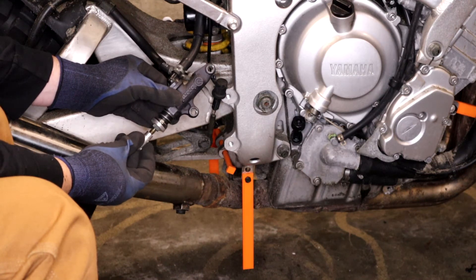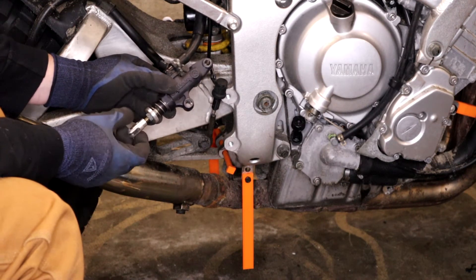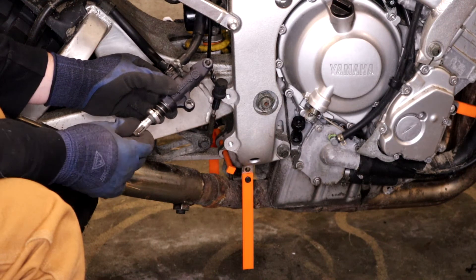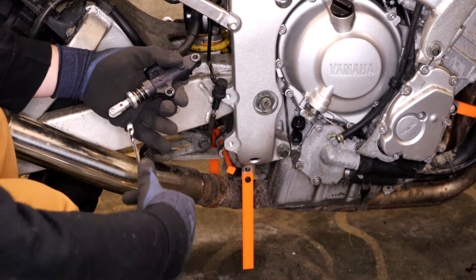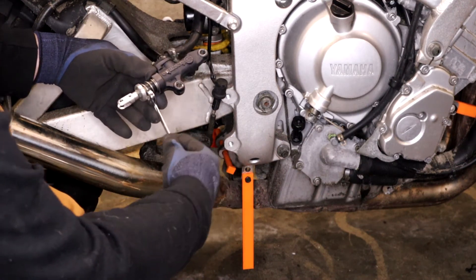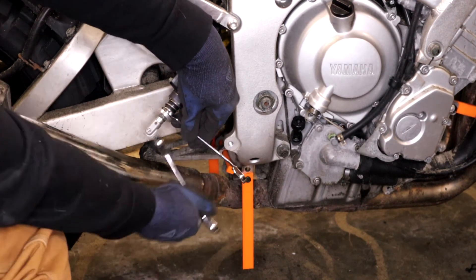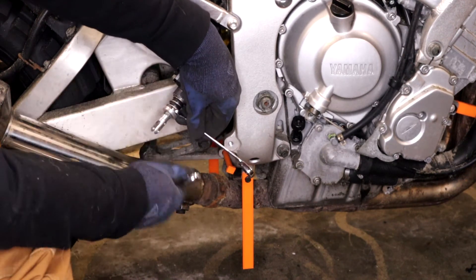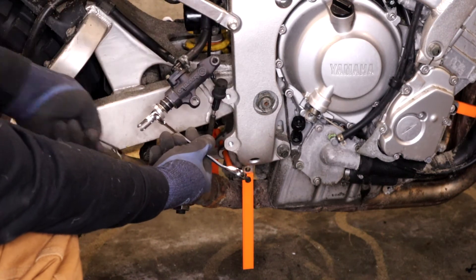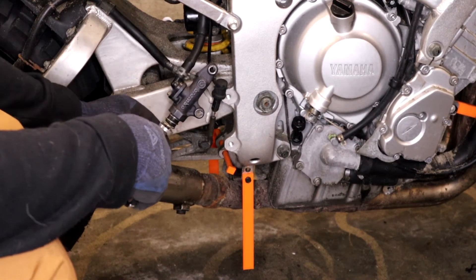Do be careful with this first thread — it's going to be real awkward due to the design of most of these main activation plungers. Be very gentle when you're putting this on because you don't want to cross-thread this and basically destroy your master cylinder. Then take your 12mm and lock this down for now. You've got to kind of force the springs away and then use your 12mm to lock it down against the fixture. There we go.